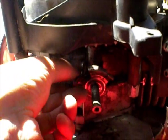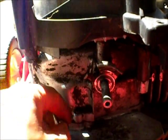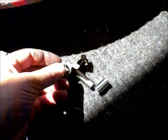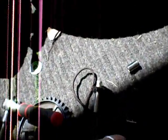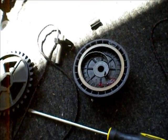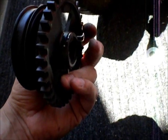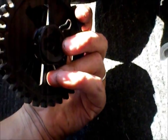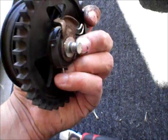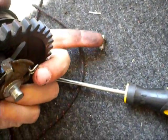One of the things that's been confusing me, which isn't in the instructions, is you're supposed to remove this bolt, and then this whole assembly slides out. That's not in the instructions, and that's what's been confusing me. The assembly comes off, and then you assemble the whole thing together and wrap the cord while you're doing that. The order of operations is: metal washer goes towards the pulley, plastic washer under that goes on the inside, and then this goes inside with the cam in between those two little armatures — with the cam and the shaft removed, and the set screw, which locks into that hole right there. This is a special set screw with a little tip on it.